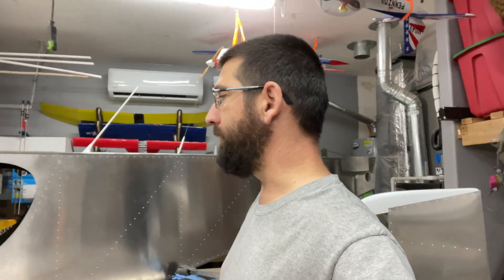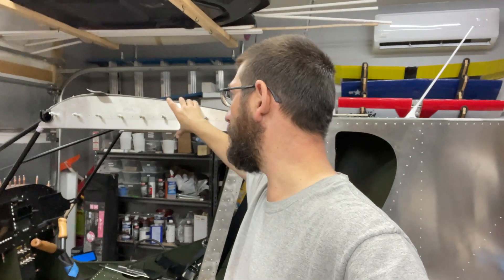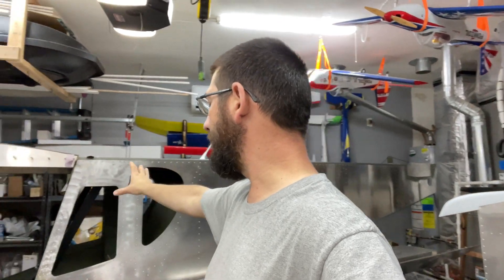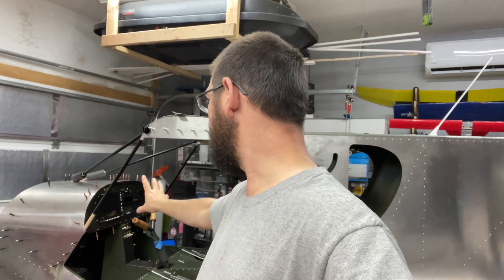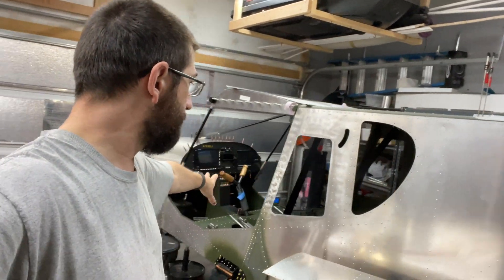We're going to get everything all prepped. The other few things we're going to be working on today is also final drilling these holes here, so that way they're all ready to go. These are going to be painted off the airplane, and then we're going to wrap the cage in paper and masking tape to make sure that the black stays black on there, and then basically just cover the whole thing up with plastic. The panel up in the front — the front skin — I'm going to paint that probably off the airframe, because I think it's going to be a little bit easier, so I'm going to have to pull the firewall and get that panel off. And we're going to pull the instrument panel out of there too, because I don't want to get any paint on my instruments in there.